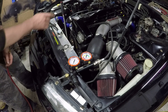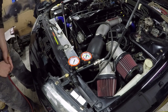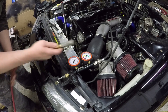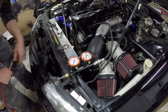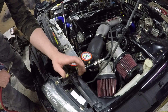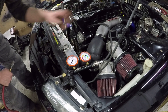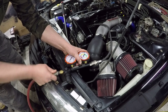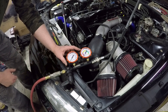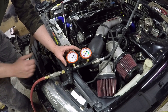I'm pretty much set up and ready to go. I've got the fan blade off and out of the way. I have my power bar right on the crank — it's a 30mm socket that you'll need for the crank. I've got my leak down gauge hooked up to number one. I'll be turning the engine over until I see some variance start to happen, indicating that the valves are starting to close up, and then I'll start cranking up some pressure to see how much leak down actually leaves that cylinder. I do have other videos using this gauge with more description on how it operates — I'll try and remember to leave links in the description.